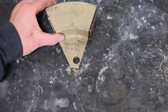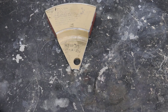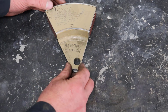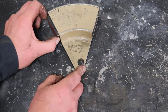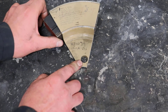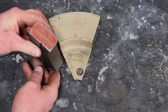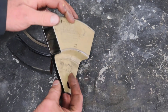This is a cutaway of a viscous style dampener — we cut a pie shape out of it so you can see the inside. You can see where it mounts to the crankshaft. These are generally used on much heavier duty engines. Inside, there's a big round weight that just sits inside and can slide back and forth, again acting like the flywheel. I'll pull it out — it's just a solid piece of weight, and that's what it looks like inside.